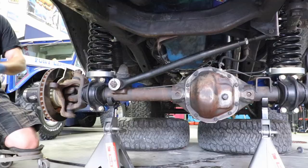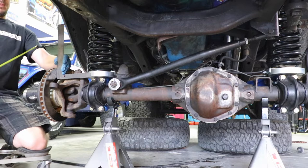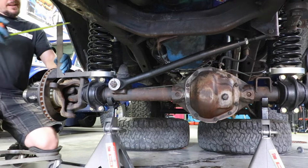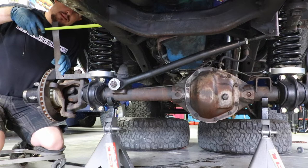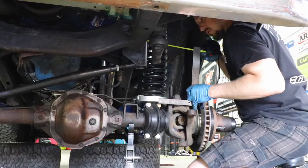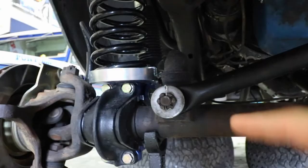What we're going to do is measure from the face of the rotor to the outside of your frame, and we're going to do this on both sides. There's more than one way to do this, but I like to use the rotor face versus the side of the tire. I'm going to lay it up flat against the rotor, grab my tape measure and put it up against the frame, poke my head in and take a look at the measurement, then compare it to the other side. From there, I can determine just how close to center I am and make my adjustments as necessary.